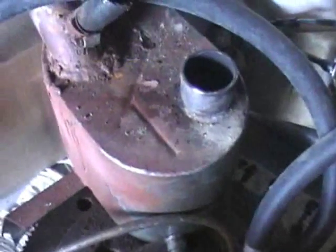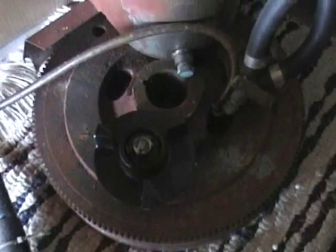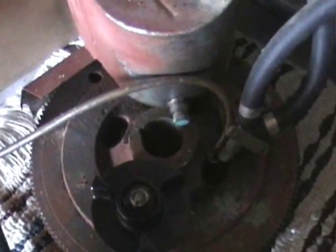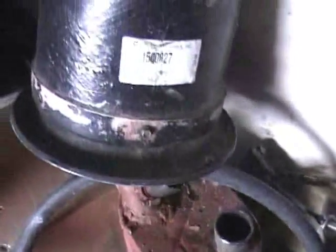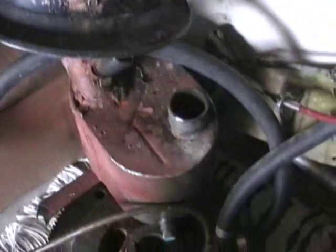I don't know much about this transmission device — unlike the motor, which I've taken apart and reviewed the manual pretty thoroughly, I have not studied much on that. Here are just a few more pieces: we've got an exhaust lifter, some cabling for the shifter, and a flywheel — a big heavy thing, probably 20 or 30 pounds. The total weight of the motor is about 340 to 370 pounds. In pieces it's possible to move around fairly easily, but all together it's really a bear to deal with.